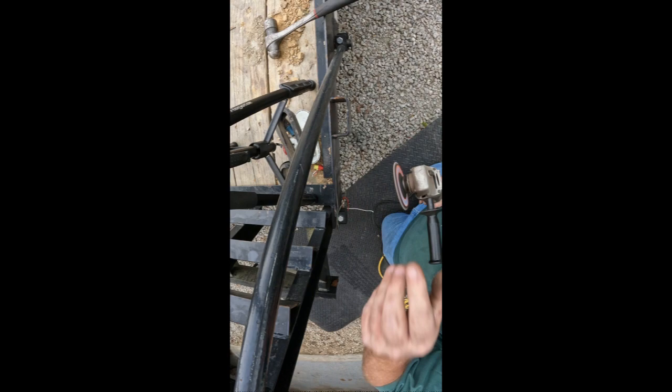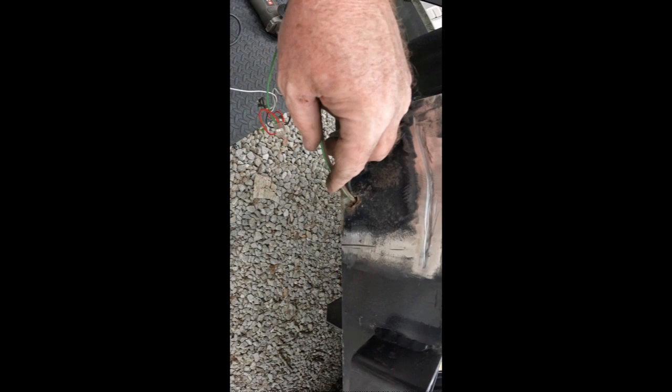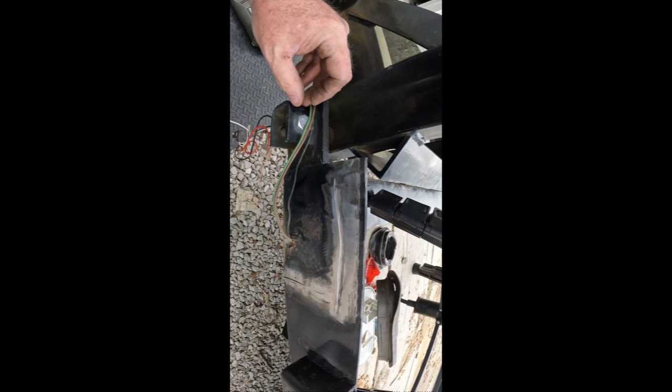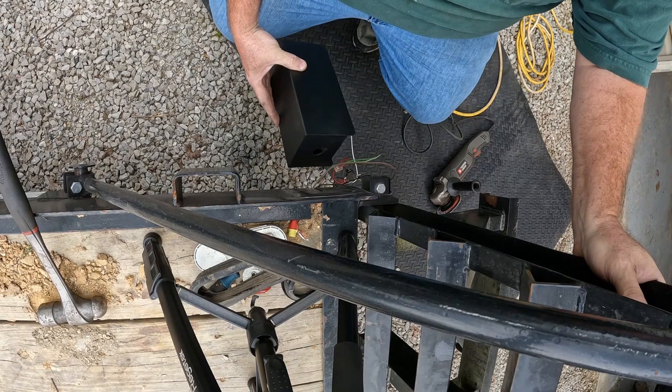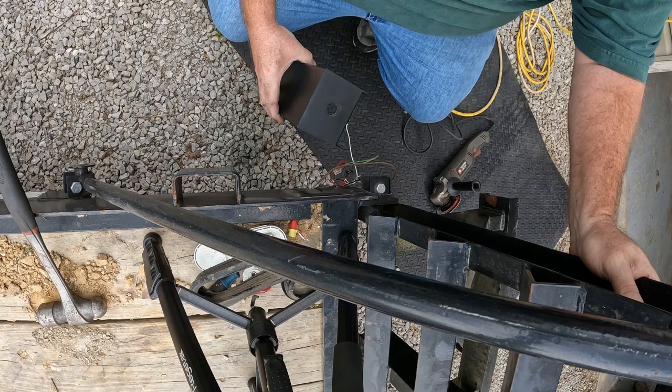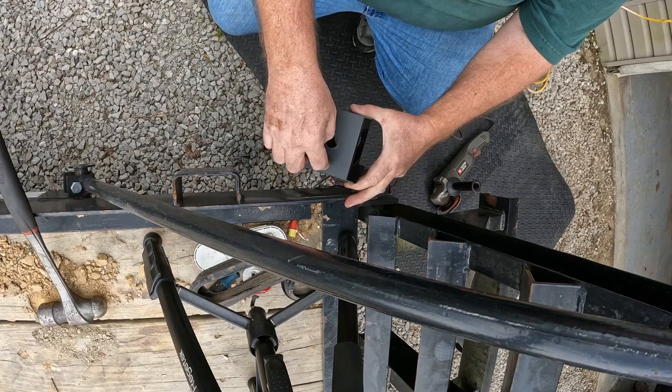I cut into the main steel a little bit. I didn't get very much down there. Well, let's blow that out with a plasma cutter or something. It's crazy. Now I gotta fit my other piece up here and tack it on. I guess I need to get my welder set up. Well, that's not going to work. The hole's too low. There's no way that's gonna line up with that. But somewhere, I've got a sheet metal step drill that should be able to drill me a hole here.